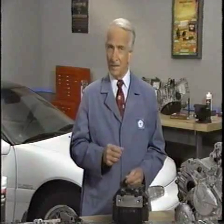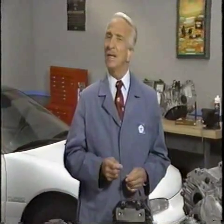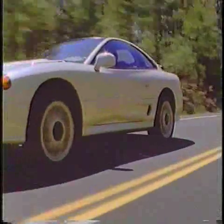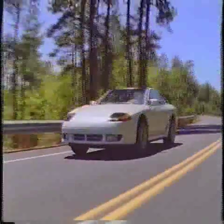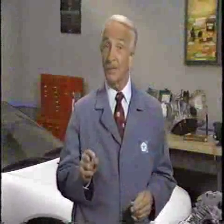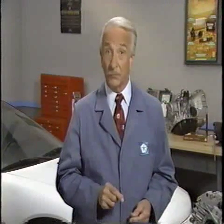With the increased availability of all-wheel drive, you may find customers assuming that an all-wheel drive vehicle ought to be able to tow more than a front-wheel drive vehicle. In fact, while the all-wheel drive system is designed to enhance traction and performance, it is not designed to be used for towing. As a result, Chrysler does not recommend trailer towing with these all-wheel drive vehicles.